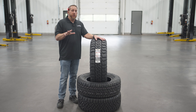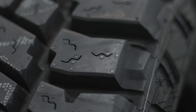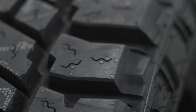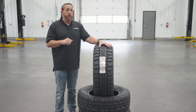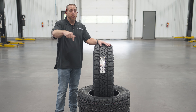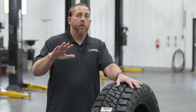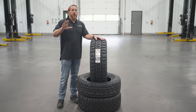On the scale of try it, wash it, or trash it, I give it a try it if you're in the market for a good hybrid tire. I would have liked to see more siping in each tread block. The tread grooves do a great job of evacuating water from under the tread to reduce the risk of hydroplaning. I think the hybrid tire terminology might be changing to rugged terrain. The bottom line is I think this is going to be a pretty good tire. If you have any questions or you'd like to see me do a particular review, drop them in the comment section below. Don't forget to like and subscribe.